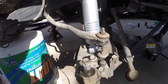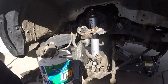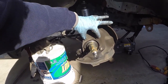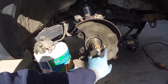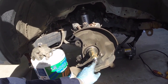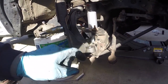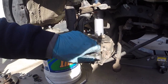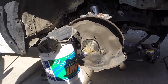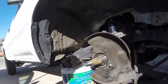It's time for reassembly of the new spindle. Get your new Belltech hub on, tighten both up, and go ahead and put on new cotter pins. Next, put on your dust shield. These two bolts were part of the original assembly — my kit didn't include them, but I found two with the same thread pitch from my extra hardware and used the original washers. It looks like it hits the tie rod end, but I'll be able to just bend that forward a little bit. Next, go ahead and lube up the new spindle with multipurpose grease and wheel bearing lubricant.